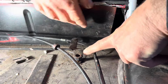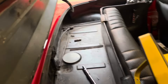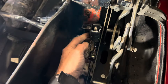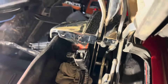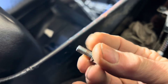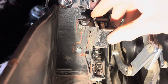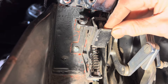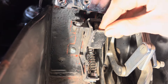Sometimes it's easier to lift this off in order to thread the wire into there. Once you've threaded that wire in, you can attach this bit, but before you attach it I would suggest putting a cloth there so you don't drop the nuts, bolts, and washers down that hole. Obviously we will be replacing all of these fittings with stainless steel fittings and new spring washers. If you ever need to take this off to change a cable, my advice would be to either draw around it so you know exactly where to put it back, or use masking tape to mark the edges.